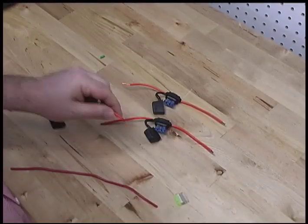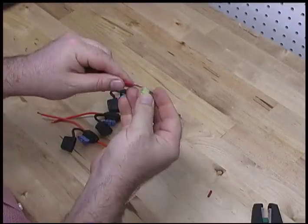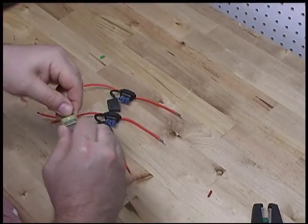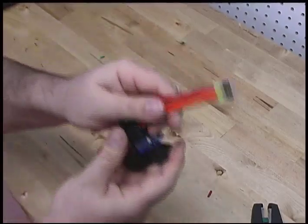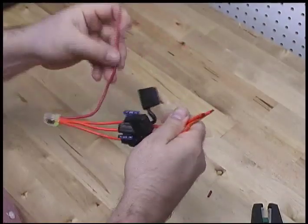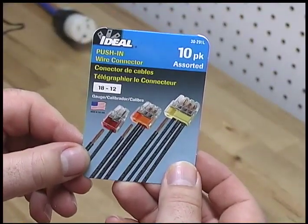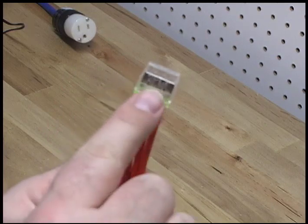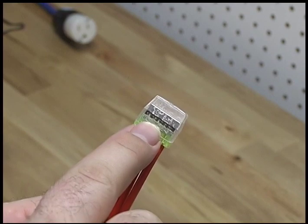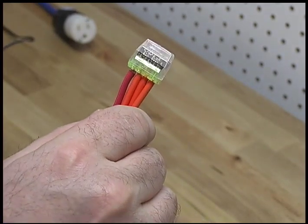You will need a fuse holder along with a 20 amp ATC style automotive fuse for each jack that you install — every jack gets its own fuse. To join the fuse holders together, you can use wire nuts, solder them and tape with electrical tape, or better yet, use captive wire connectors from the Ideal Corporation. These Ideal connectors are quick connectors requiring no tools — you just strip back the wire and stick it in the hole and it's held captive permanently. It's a tidy way to join your wiring, and these easily accept hot glue to make the installation neat.